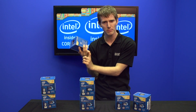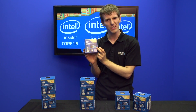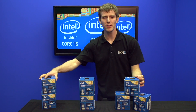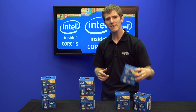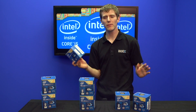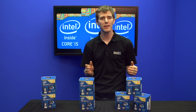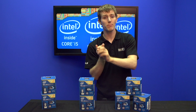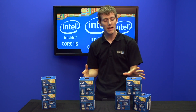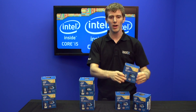There's dramatically improved graphics processing performance, as well as a shared level 3 cache between the CPU and the graphics core. Last generation, Intel put the best onboard graphics on their unlocked overclocking gaming CPUs. This time around they recognized those guys are probably going to get dedicated graphics cards, so the better graphics are focused on BGA and mobile chips. The 5000 series graphics will be found in things like all-in-ones, and 4000 series graphics — still improved over last gen — will be on the desktop socketed variants.